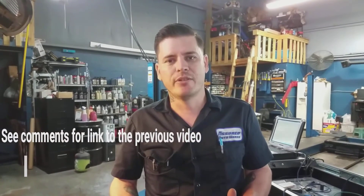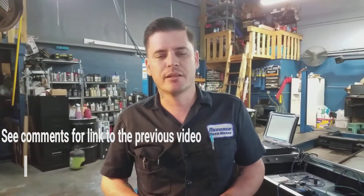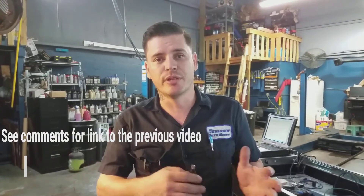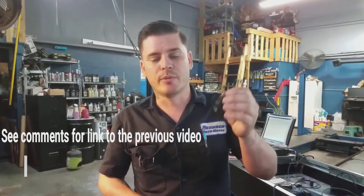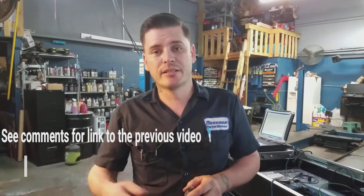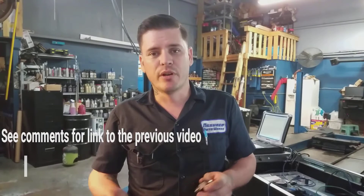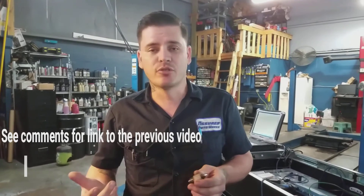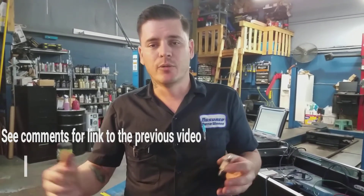My name is Bryn Klein, we've got Carlos Mercado helping us shoot this video today. In my last video I talked about setting up and saving your user startup settings, and during that video we talked about the 20-to-1 attenuator and the different probes in the built-in library within the software. This video is to illustrate again why you would use the 20-to-1 attenuator, and we're going to capture a primary ignition waveform from a 2005 Lincoln Town Car with a 4.6 liter engine.